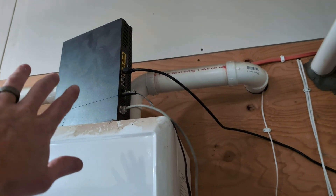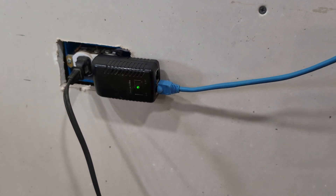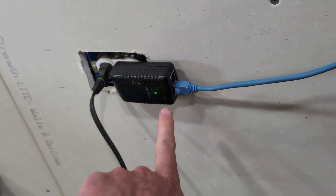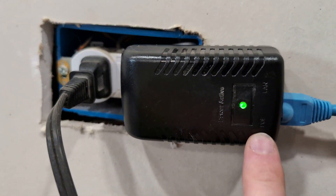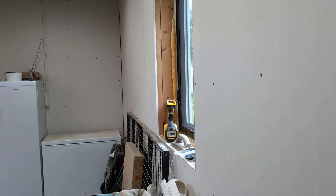From the router, we're going to go outside and mount one of the bridges. I ran out of outlet space in my utility room, so I have the ethernet cable hooked up to the PoE port and plugged in — that cord is plugged in outside in that corner to the bridge. Wherever you currently have your internet — in my case, in my garage — run an ethernet cable from your wireless router outside to the bridge, plus another ethernet cable from the power supply to that bridge. So two ethernet cables are going to the first bridge. Make sure that bridge is in the A position.